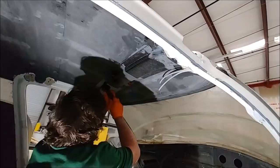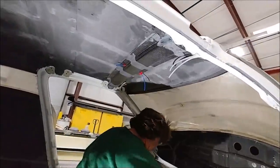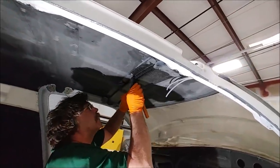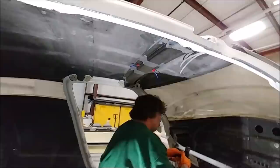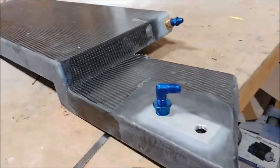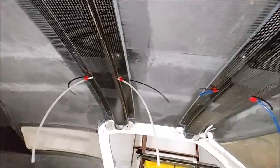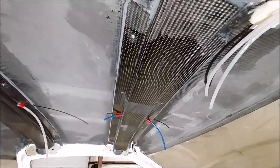We're ready to put the roof braces in place. Jeff has got the first one bonded in with hysol and is putting rivets in to pull it nice and tight to the roof skin. There's a small plastic tube going through — that's a mini conduit for the wires for the overhead lighting. Here's the other side of the back tank wall with some fittings, and now Jeff's got the rear roof brace in place as well with a conduit — that one's been bonded in too. More progress inside the fuselage.